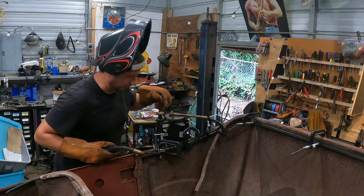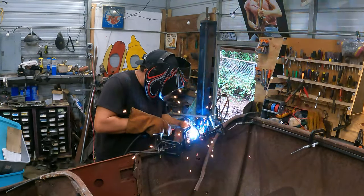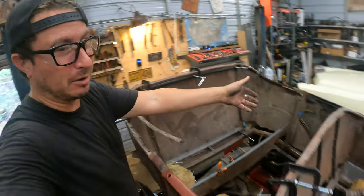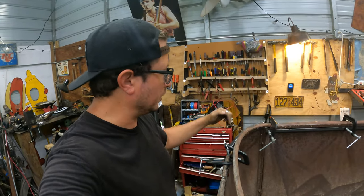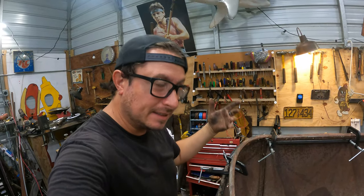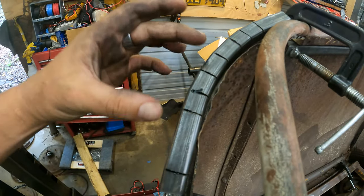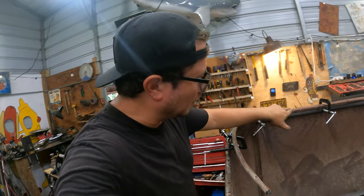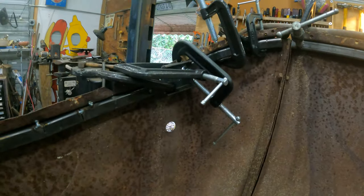Can't be going ham on these things when you're welding thickish steel to rusty rusty sheet metal. The pie cutting on the inside is a little more tedious, but I prefer that way because when you weld, if anything it's going to shrink closed. If you go the other way you can get more of a bend, but the weld might change shape as it shrinks. If you need more than one cut, just close it, then cut it again. Let's get it clamped in with 300 clamps, get this side buttoned up, weld across, and then do the mirrored version.